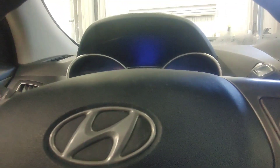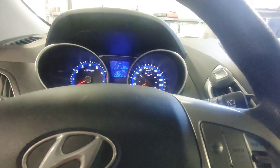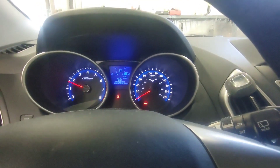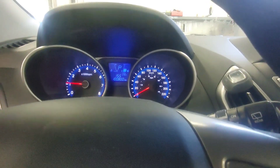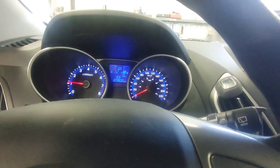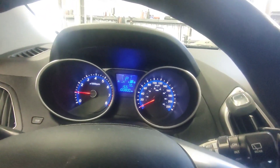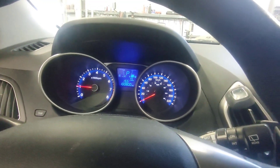This video was done pretty much live. The only thing I stopped was when lifting the vehicle — that was maybe a minute or two. Typically this whole job took about 15 minutes to fix. The car is fixed. No more ABS or ESC light — codes are off. Can you fix this without changing the sensor? Yes. But you've got to make sure you route everything in the proper spot, make sure the wiring doesn't move around too much. We'll put some heat shrink on the wiring, make sure everything is weatherproof, and then we're going to ship this vehicle. Hope you guys enjoyed it — I'll see you guys next time.